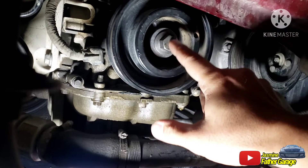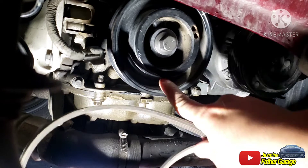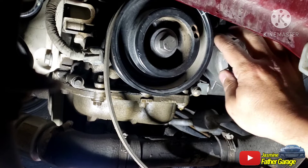Keep this crank pulley steady so that when we turn the bolt, it's not going to spin out. I got this belt here laying around — this is a regular belt. We're going to use this belt to hold this pulley against with the AC pump. To turn this tight is clockwise, so we're going to go over like this, over the crank pulley, over the AC pump.